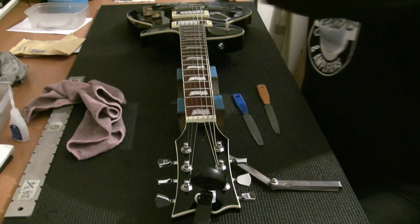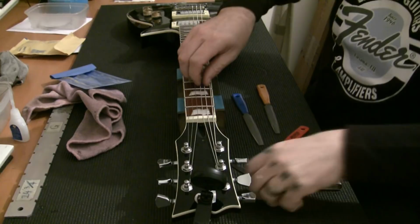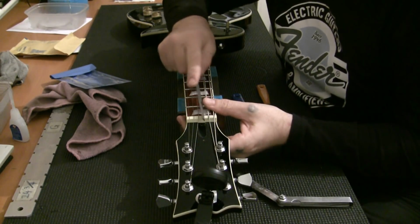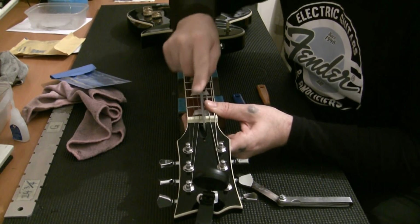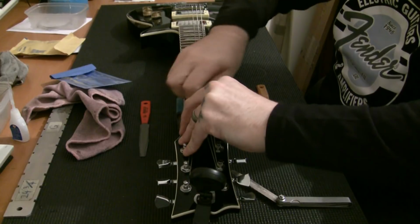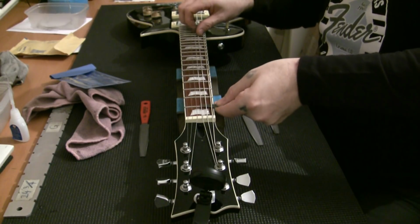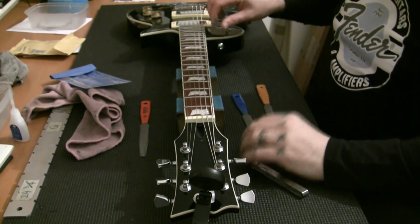we'll move on to the last file. This one being a 0.026 of an inch gauge. We are a little bit high on there. We need to widen this to about a 32, so we're going to do the same again. Just slightly widening the slot. And we're there.